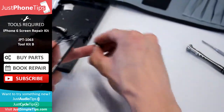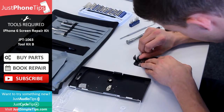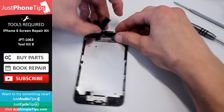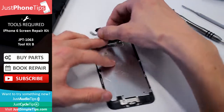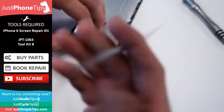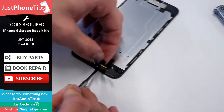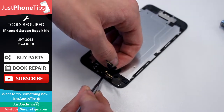We've then got the speaker. If you just want to get a fingernail under the corner, just be very careful because they are glued down. It's best if you turn the screen around and go in from the top with the case opener tool. Just hit on the clips, and then you've got the last little bit with the gold connector on the pin, just on the board — take your time with them and pull them gently.